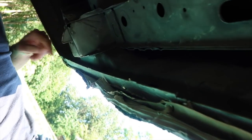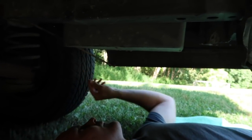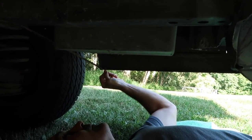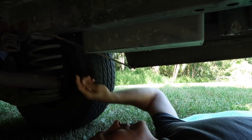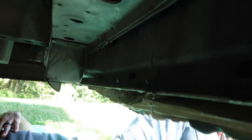Let me get a good angle here. So there are two bolts on each side — you've got this one and this one — and then in this little hole right here there's another bolt, so you've got three on each side. Then we've got to take these off; they're bolted to both the bumper and the frame. Basically 10 places total where it's connected.